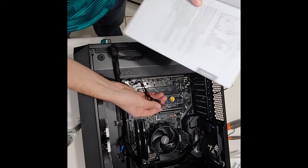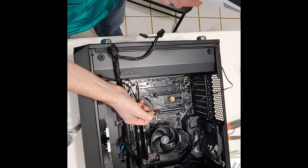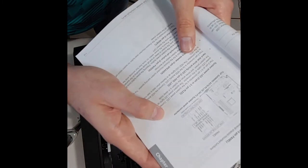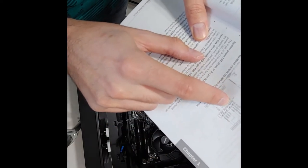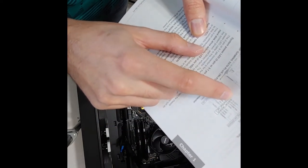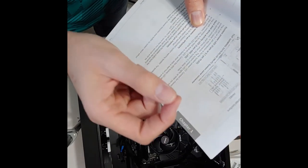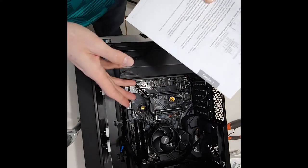To help you guys out on the connectors themselves, if you see a little triangle at the very tip of the connector, that is the positive point. So for example, when you're connecting the power switch, you'll see the power switch and then the ground, same thing for the PLEDs, you know, a positive, a negative. So if it asks you to plug in the positive, just make sure that the end with the little triangle goes in the positive spot. As for everything else, you know, you have to use your booklet to kind of figure these things out.